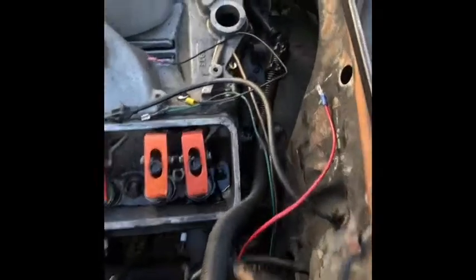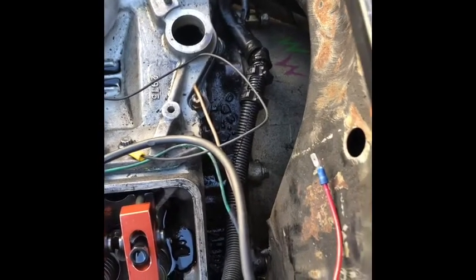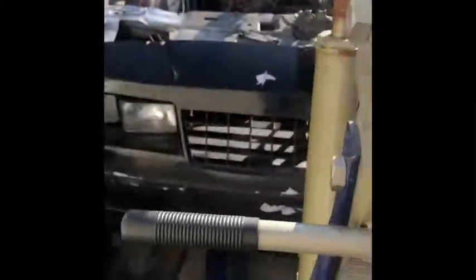It's 6 bolts connecting the transmission to the engine, and then you got the 2 motor mounts. One right here. It goes to the back of it. It's not big at all, but it got the other side. Once I take off the headers, I'll be able to show you more. We got the engine hoist ready.